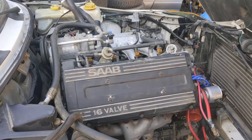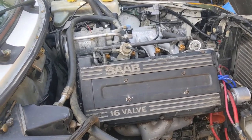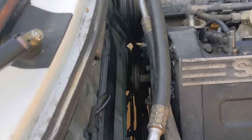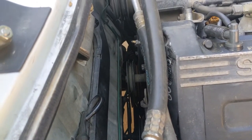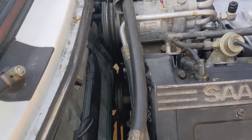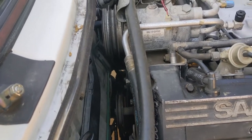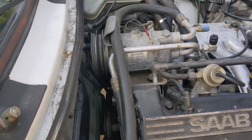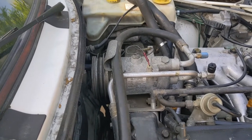We're back to it. First task today: we're going to mess with the belts. We need to take the AC compressor off the motor — I'm going to leave it in the car because I don't want to drain the system. Unmounting the AC compressor from the engine is the easy option, so we'll get to that part later. First thing: take the belt off.